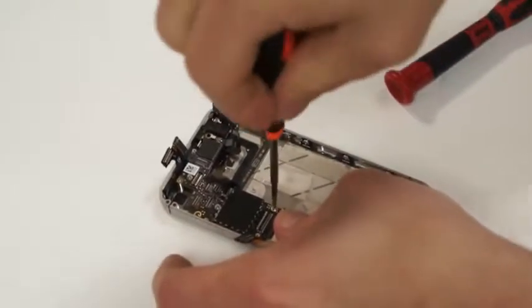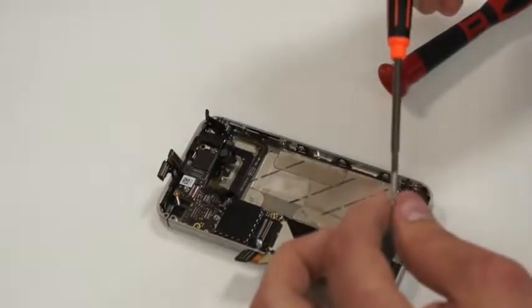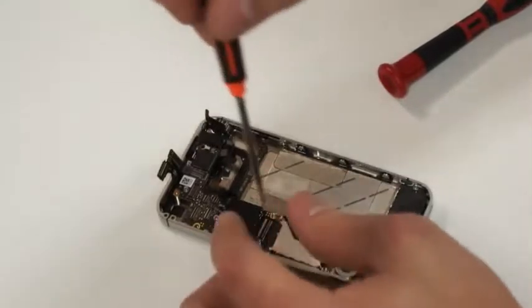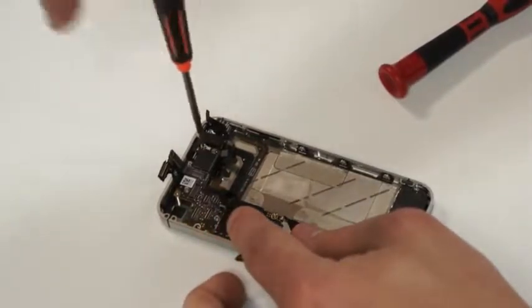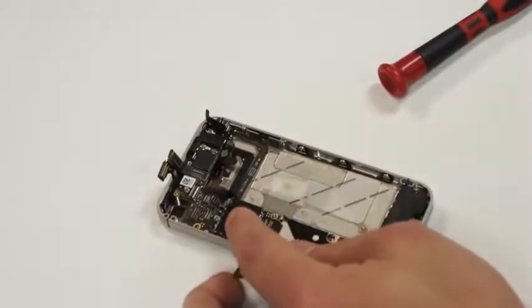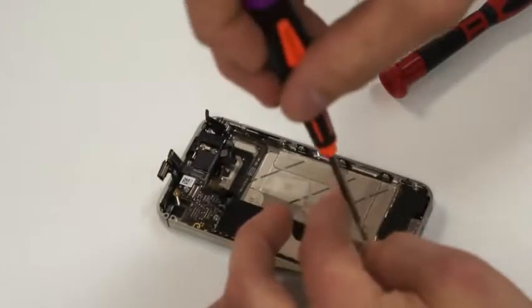And once you tighten that first screw down, it'll hold that circuit board down so that you're not fighting with it the whole time. And you'll notice with the special screws, there's one longer than the other, and that long one, if you put it in the appropriate location on the screw mat, it goes up at the top right hand corner of the circuit board. But the other two are a little bit shorter.